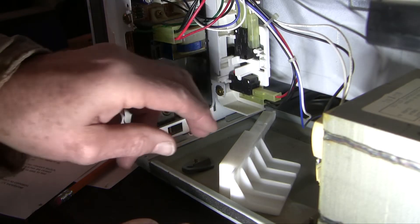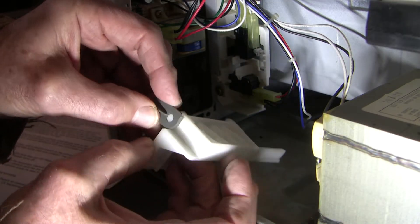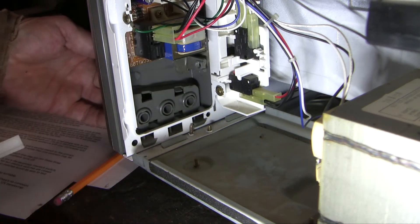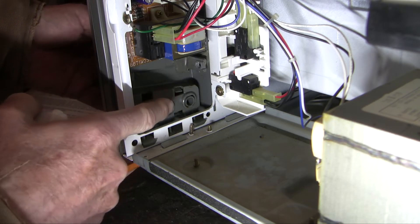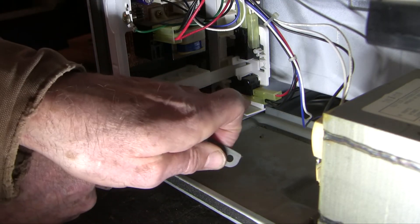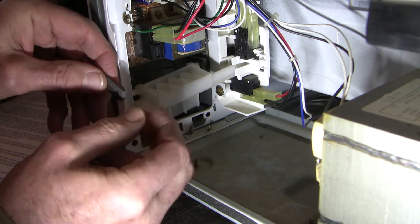Now let's focus on the problem at hand. When I opened this up, I found two plastic pieces. If you look closely, you can see that one piece mates very nicely onto the other, and there's one that's missing on this side. When you press the button to open the microwave, you press this here — you see there's a hook that holds it back, but there's no hook on the other side. So there are a couple of plastic pieces that are broken. This dovetails with the primary interlock switch right there, so this piece goes right in here. I want to disassemble this enough to see if I can glue this back together.